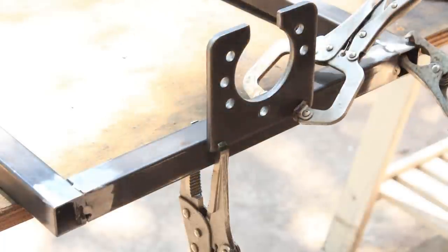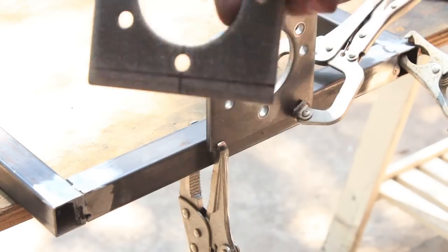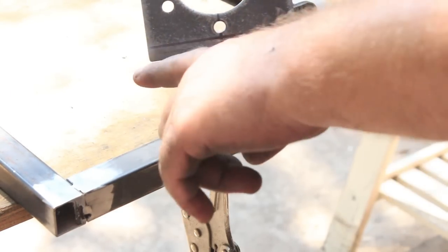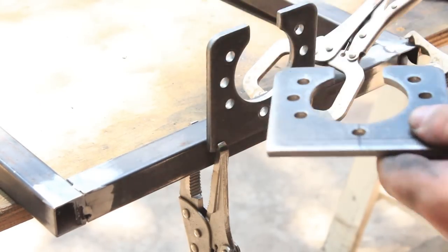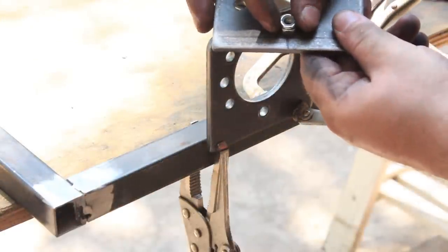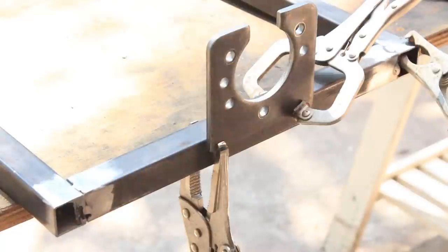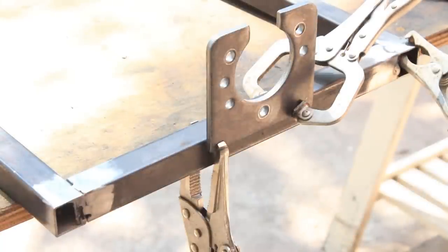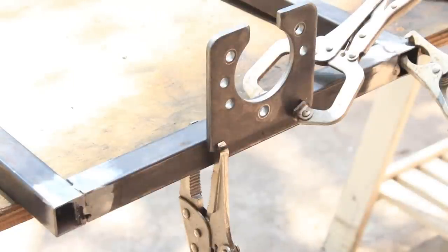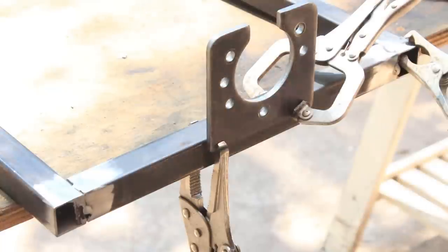Here's our ghetto-rigged right-angle holder. We're basically going to tack this in a couple places, then go around and do all four corners — that will give us a square rigid frame and then we can get the axle out here and get it mounted. So there's our rear box. We are 29 and just under three-quarters on all sides — a nice little square box. I'm going to go through, tack up a few more things, grind it all down and clean it up, then mark out the middle and get the clamps off the axle and get it on here.